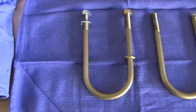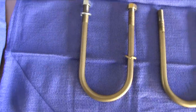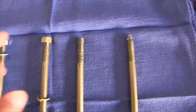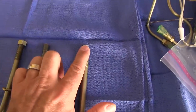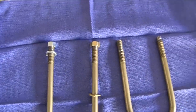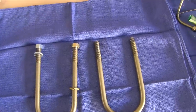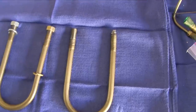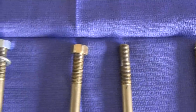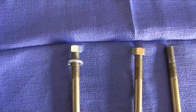I got the new U-bolt — not new, but I got it off the green car and powder coated it gold. Just going to use a nickel plated nut and washer. What happened on the old one: one of my brand new nuts that was supposed to be a 1.25 thread pitch was actually a 10x1.5 thread — and that's why this happened. Now I have two known 1.25 nuts, guaranteed.